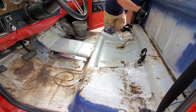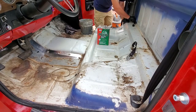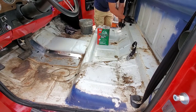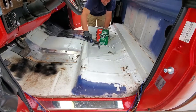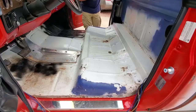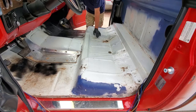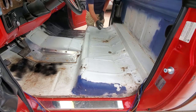One of the things you won't really see here is that any spot on the floor that is not in real good shape is going to have to be treated with some paint and/or primer. Right now you can see I'm using prep-all as another step in cleaning everything before I even do that paint. There it is right there — the black was just used because we're going to cover it all up; that was just any area that was not completely covered with paint. You can see there's the multi-purpose adhesive that we're going to spray the entire floor with, the purpose being to stick down our underlayment, which is the next step. This particular brand works really well for me — there are others, but I'm just showing you what works for me each time.